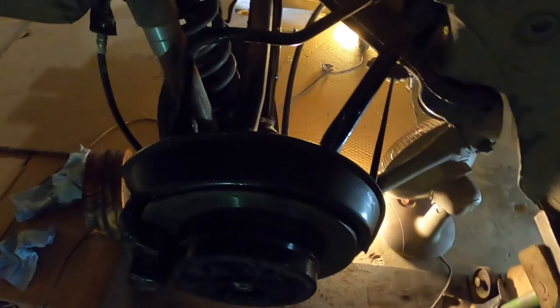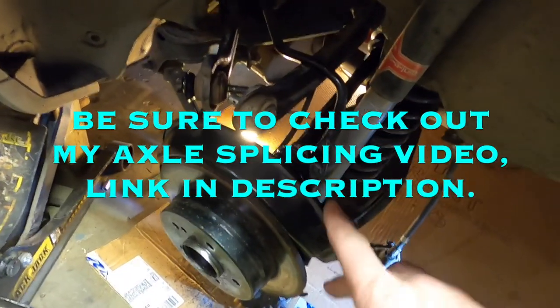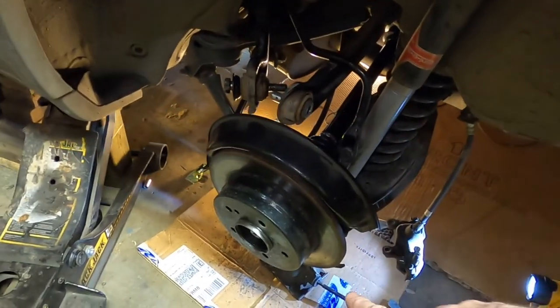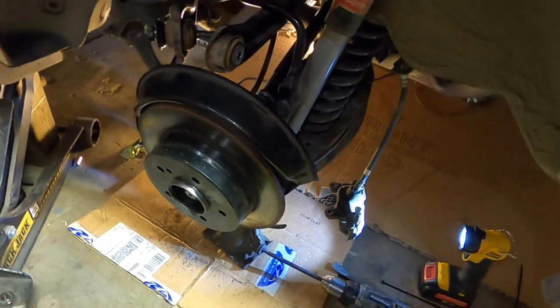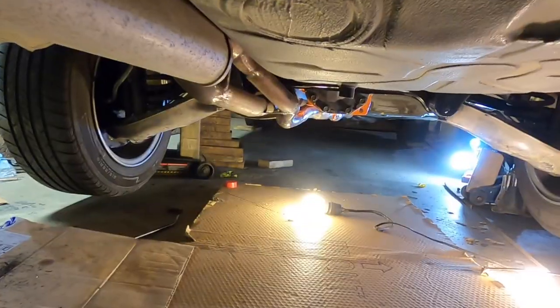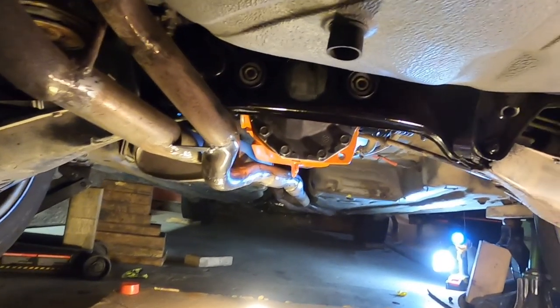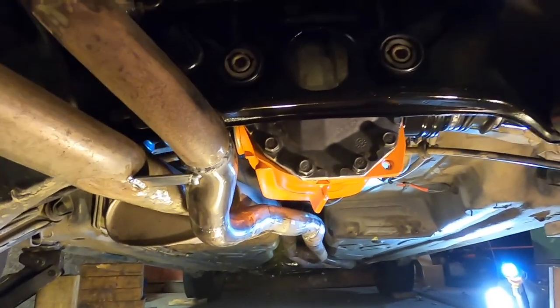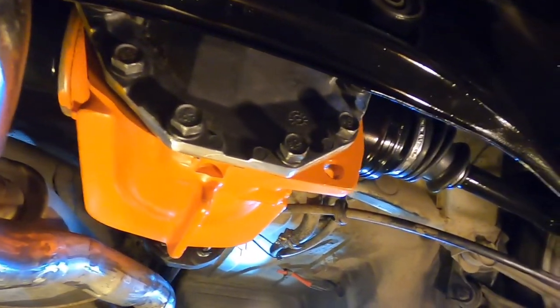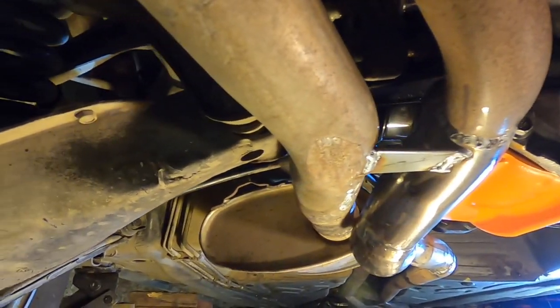Just a little update here: I've got both axles in. You can see a really nice angle and everything on that, and I got the other one in — fits perfect as well. I just have to put the arms back on the hub; I had to take all these things off and lean it out to get that in. That's why Mercedes used a flange style on the differential. It's 100% done — I got the wheels on, I'm ready to let the jacks down and go for a little drive. You can see those axles will sit about level when the car is down on the ground.